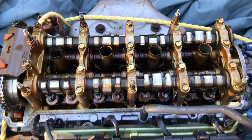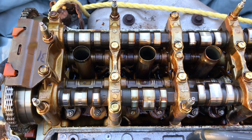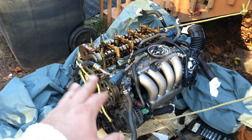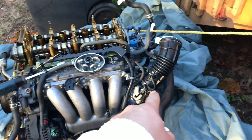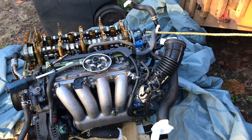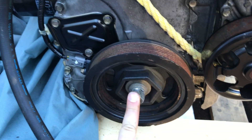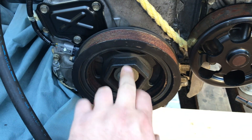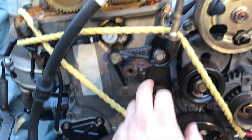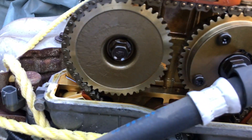Let me know what you guys think down in the comments below and let me know what other videos you want to see. I'm probably going to document this whole thing. Got the K24A right here, so I'm probably going to tear down some accessories today — maybe the power steering pump. A lot of this stuff I can sell. I'm going to measure the throttle body real quick just to see exactly what year it is, because I know the 04-05 is at a 60 millimeter throttle body and the 06 to 08 has a 64 or 65 millimeter throttle body. Also there's a mark here on the harmonic balancer — the crank pulley bolt is on there so tight, I'm going to have a problem with that. I still want to change out the mount and get the CRV mount.